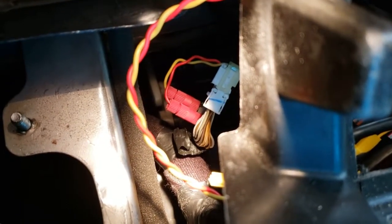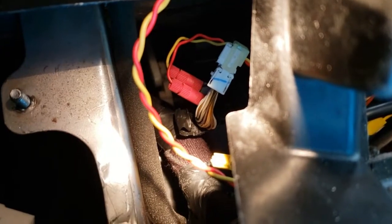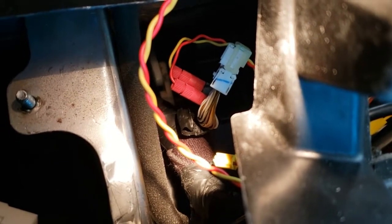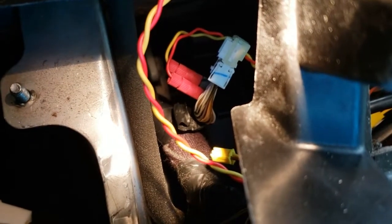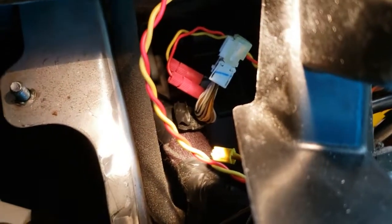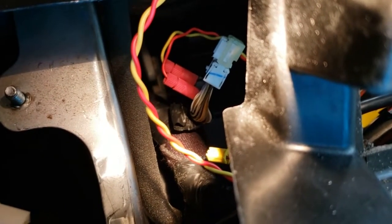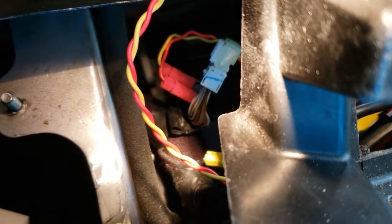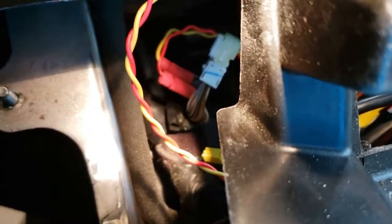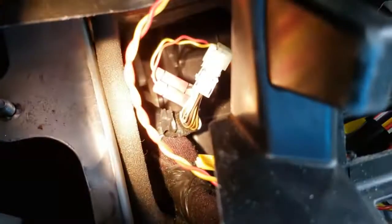The Positaps are now completed. After they're tapped into the harness, you strip the wires that go in there, put them through the end cap, and screw the end cap on — that connects the new wires into the harness. I tested the radio and that connection is working. That's what the Positaps look like, that's how they function — they work pretty nice.